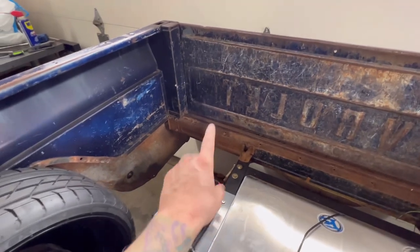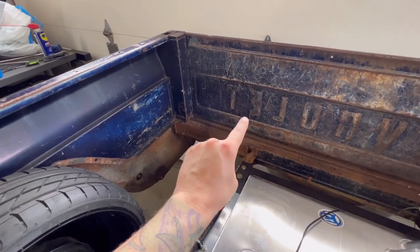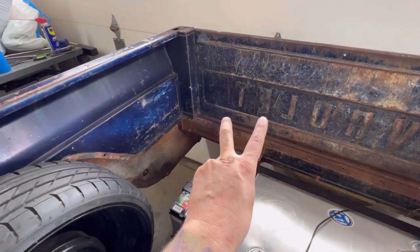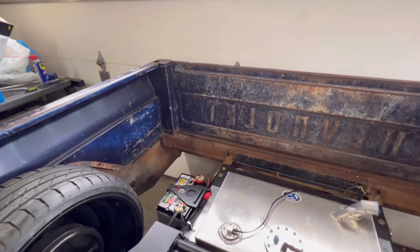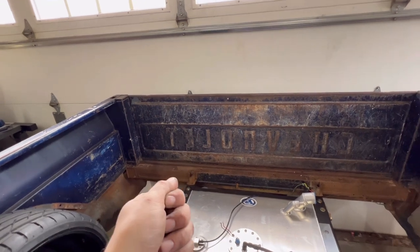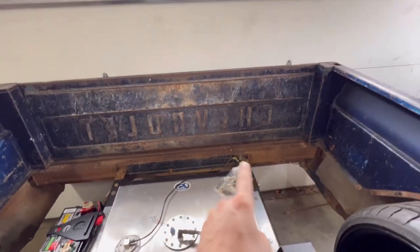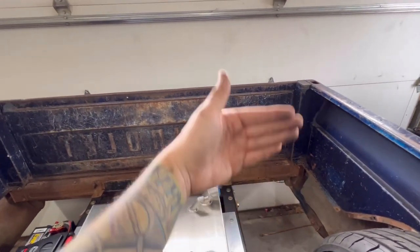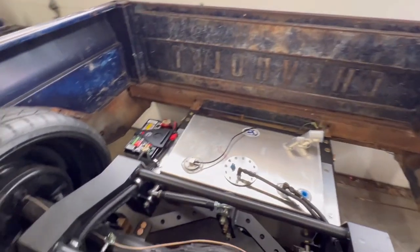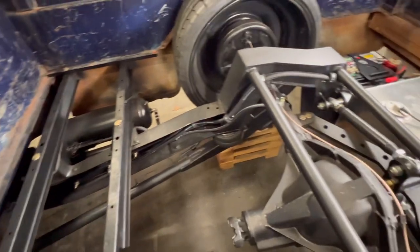And then also over here, I'm working to get a battery terminal insert that goes into that section that has the two terminals for your battery and then a battery turn-off switch for that. So when you put the tailgate down, you'll have a place there to connect jumper cables or any kind of electrical thing, or to turn your battery off, or to hook up a battery charger, and your fuel fill all on the backside, kind of that raised bed floor section. So no holes in the bed floor. I don't have to worry about it tilting anything. Just trying to come up with something different for that, but the back is getting really close to being done.